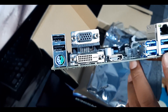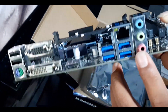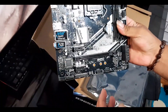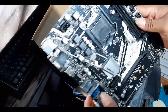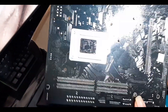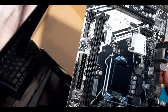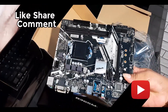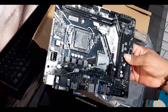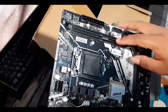This motherboard lacks the necessary USB Type-C port. The M.2 slot is under the graphics card, which is known as a warm place on the motherboard. Also, the space between the M.2 slot and PCIe X16 slot is narrow, however they don't block each other in any way. The controllers equipped on this board are of cheap quality, and I would recommend you to consider some premium choice of this chipset. ASRock B365M HDV is placed on top of our list because of its price and features, however I would recommend this only if you are not going to spend much on the motherboard. It would be much better if this board came with an additional 2 DIMM slot and a USB Type-C port.